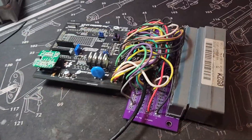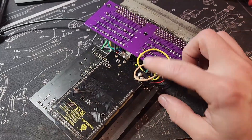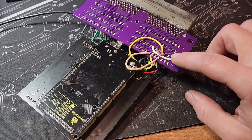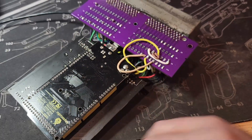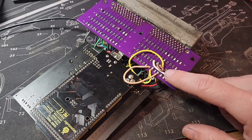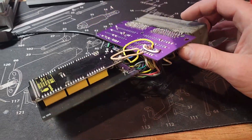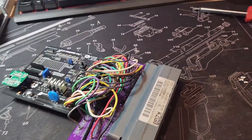At this point it's ready to close up. These are the jumpers for the batch fuel injection to get all the fuel injectors to fire correctly. The 5.0 harness by default has sequential fuel injection, but the 4x only has four outputs, so that batches them up in a certain order. That combination of fuel injectors and even the ignition circuits will be on a spreadsheet - I'll have a link in the description for how this is all wired up, so if you're planning on doing this build you'll have a good set of bones to follow.